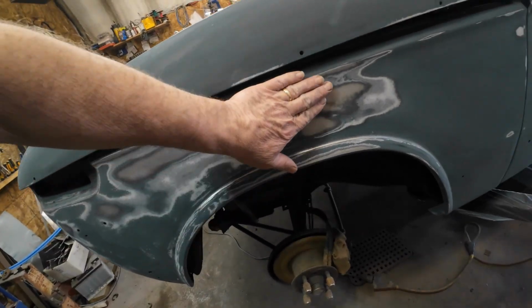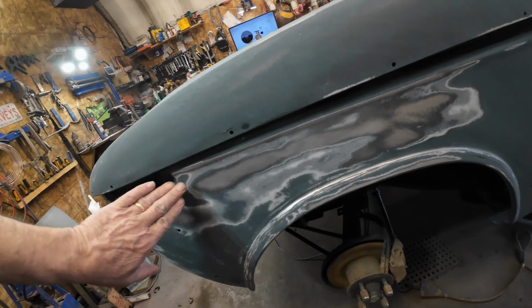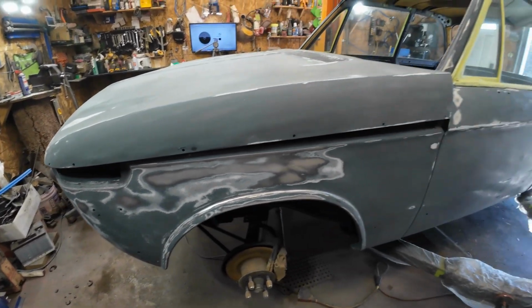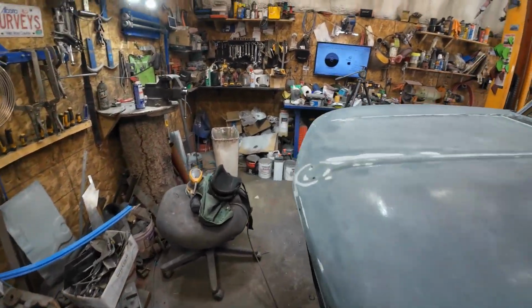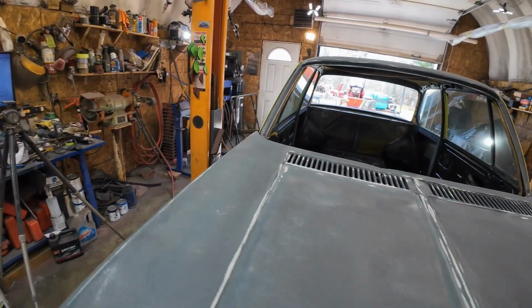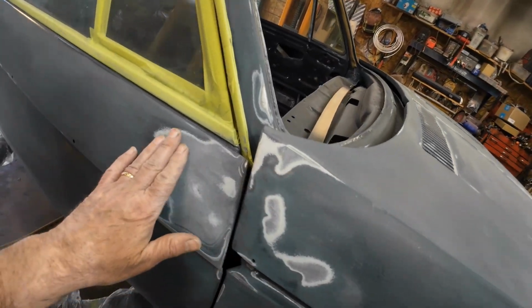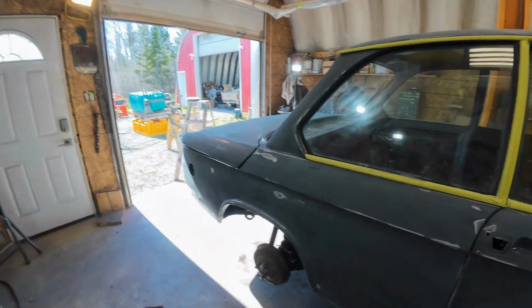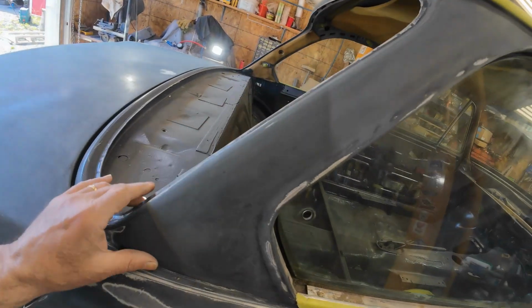And this bit here, if you remember when I painted it, there was a ripple in it right here because I hadn't sanded it enough, and I think I've got that sort of cured there. Seems to be all the bad bits are gone for the most part. When I got into the heavy bad bits, like in here, then I used 40 grit to just cut through them because the gummy stuff was plugging up the other.